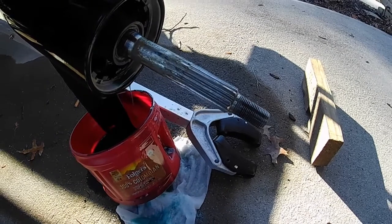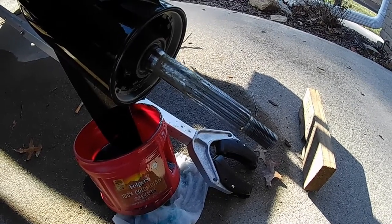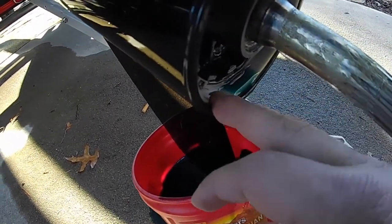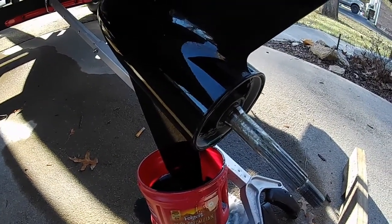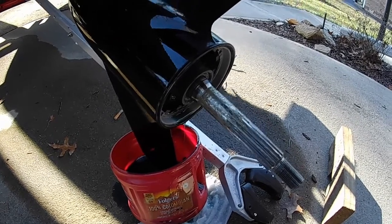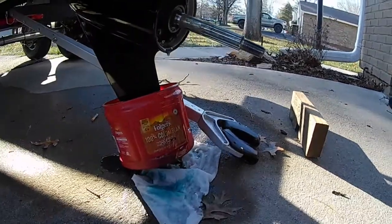So basically, to stop it, you can check the torque on your prop. If your prop seems to bind in this area where this plastic piece is at, and if you have a painted prop, take a piece of sandpaper and knock some of that paint off. Usually the paint pulls on one side and it makes it fit wrong.